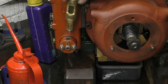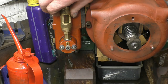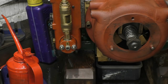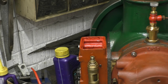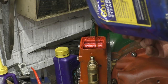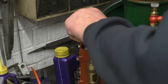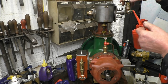Screwing the pump back into place — that port there is actually full of oil, of course it would stop at one side. You can see the side glass there. I'll start the engine up and bring the camera a bit closer, and hopefully you can see what goes on. This is special oil formulated for steam — real thick, sticky stuff. Going to oil it through the inlet port; it needs to lubricate the piston and the valves.